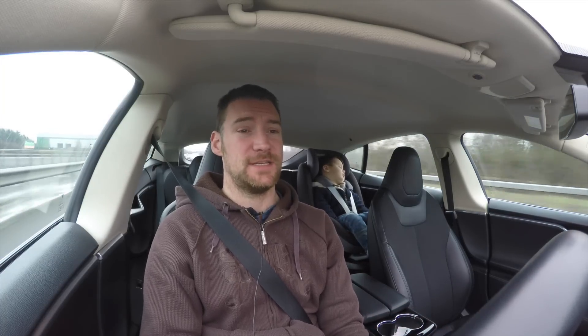The Bolt is an exception — it does over 200 miles of range and seems like a very capable car, but unfortunately it's also a very absent car in the UK. It's been an interesting decision and a real differentiator between Teslas and other EVs. Over time they've realised they can use a slightly larger cell, increase the power, and reduce the wasted weight in space — that's why they've moved to the 2170 cell format. They'll probably stick with that, depending on how things go at the Gigafactory and what battery advancements come out in the future.